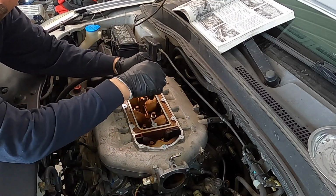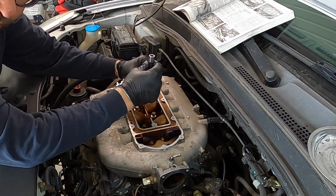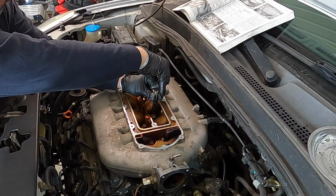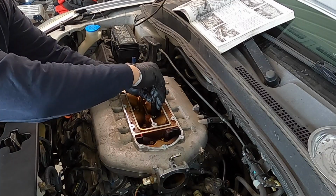I like to turn the bolt backwards until you feel it drop and you hear a little click, and then you know the threads are lined up, and when you drive it forward, you won't strip the threads. I'll do it on this one for example. See? You heard the little pop? I'll do it again. There we go. Now I go forward and then you're in the threads.